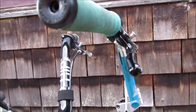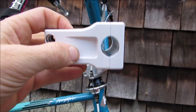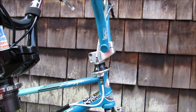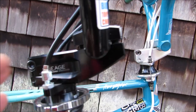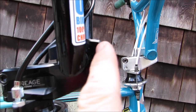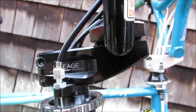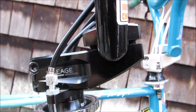Now, this Haro Master, let me grab this. Had a front load stem. Now this front load stem just kept my bars a little lower, so it wasn't giving me that kind of feel that felt comfy. Now this stem has 32 millimeter stack height, 32 millimeter rise, and I believe it's like a 53 millimeter, I could be wrong, reach.